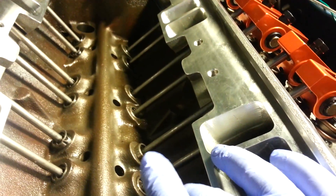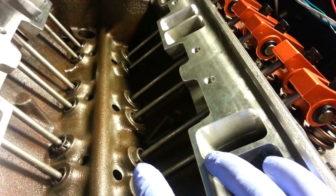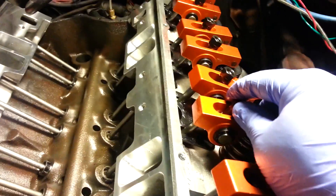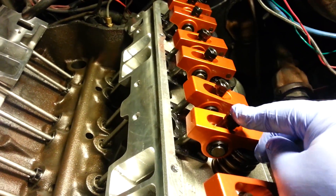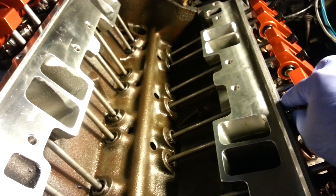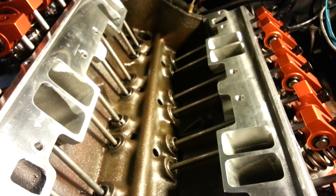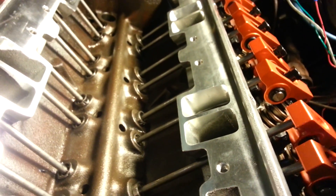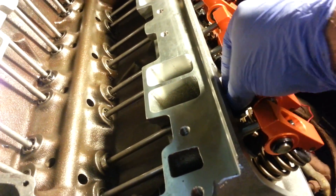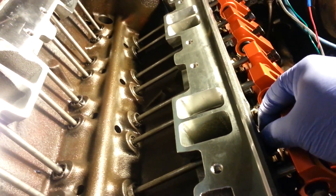So when the exhaust starts to open and I go about halfway on the lifter, you know that you're open and you're fully seated on the intake. Then you're going to come over here to the intake and tighten it down. These Harland Sharp rockers — they have polylocks and you're going to twist the pushrod. You can twist it up here if you have the intake on, or down here. Tighten this down until it's snug — it can turn freely, but you just don't want to have any movement. You can see it's moving — you don't want to have that play in there. Tighten it down until you can't move it up and down anymore.